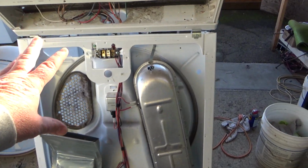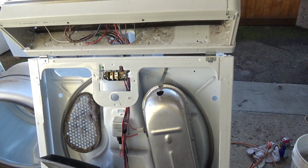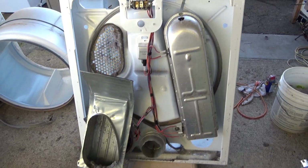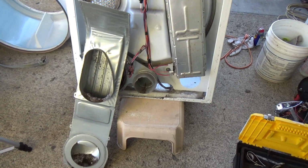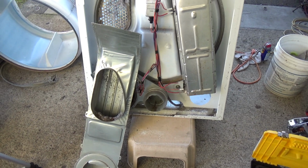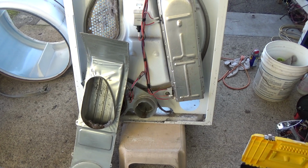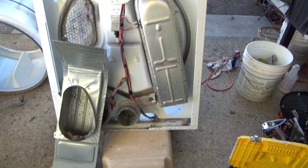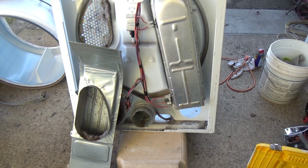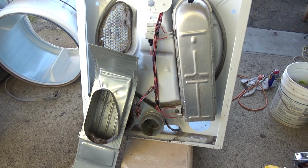You should really try to understand your wiring diagrams and your wiring and test things out. If you get really good, you should be able, from the control panel right here, to figure out a way to test out just about every component. The only one that gets hard is that plunger thing, because I haven't figured out a way to activate that without pulling apart, you know, taking the drum out or at least the front end off or something. But maybe you could make a little tool that you could stick in there and pull, I don't know. But if you could get that little piece done, I guess you could pretty much test everything out except for that.